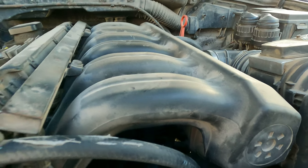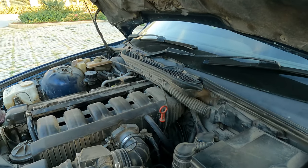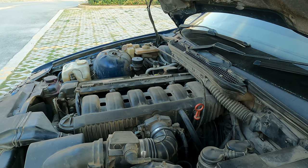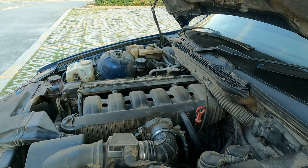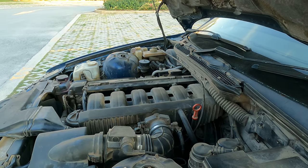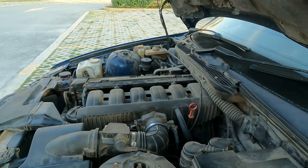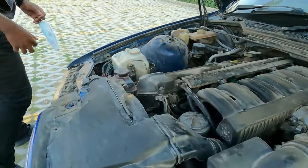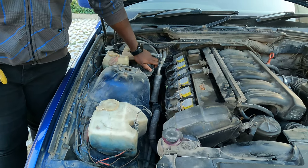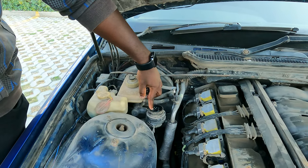Gotcha, but to get to it now, you would need... Wait, hold on. So you're saying you can't read anything off the map right now? Well, when I carried it to Bolas, that's what they were saying. So we haven't really tried to read the map. Let me see, where's your OBD2 port? I'll just grab my... I don't have a 2, I have a 1. So it's a 94. Ah, gotcha. We're actually trying to get the 2, and have the laptop with read software to read it and stuff. But I just can't get a straight connection to the ECU.